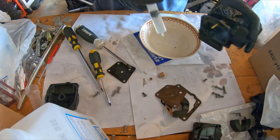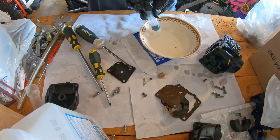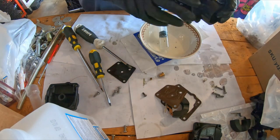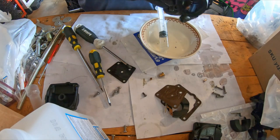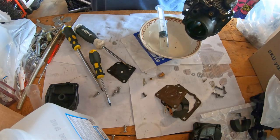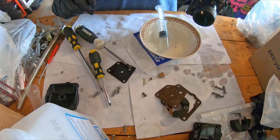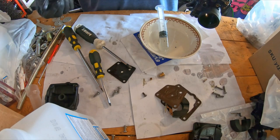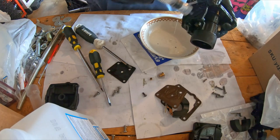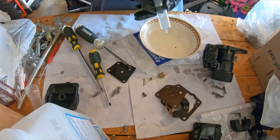I'm going to make a second video after I get this all back together, covering adjusting the needle valves, which are on the manifold still on the motor. The needle valves meter the amount of fuel that goes through. The spec on this motor is five and three quarters turns out from seated. I went ahead and turned one of mine in, and it was sitting all the way at nine and a quarter turns out. So either someone adjusted it indirectly, or adjusted it for a dirty carburetor situation. Hopefully once I get these all back together, I won't have it so out of spec.